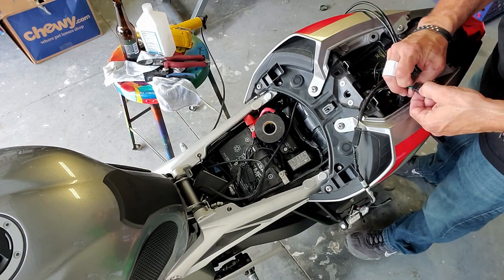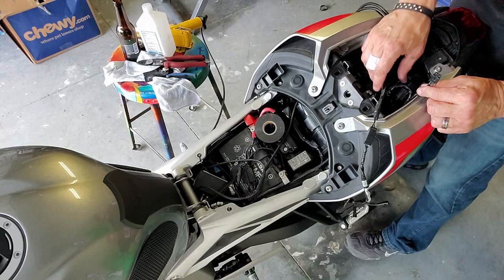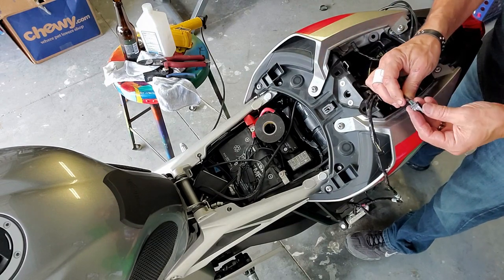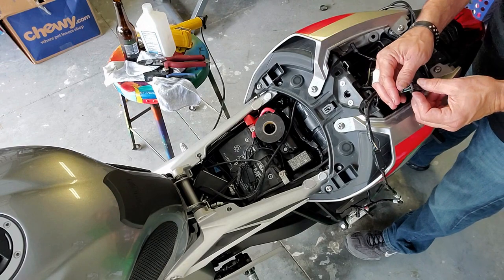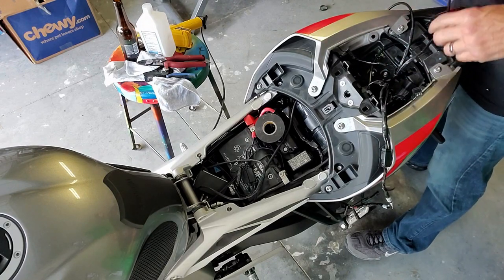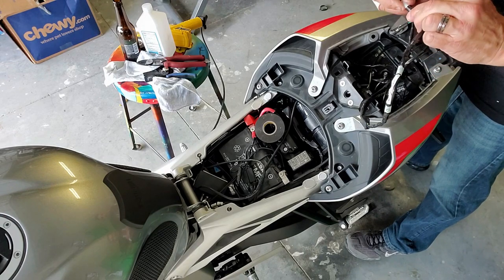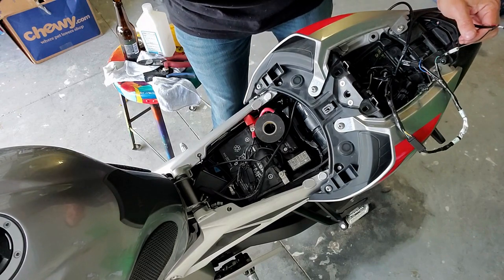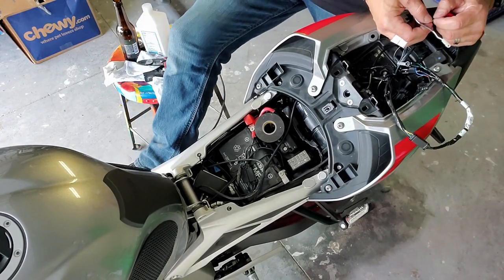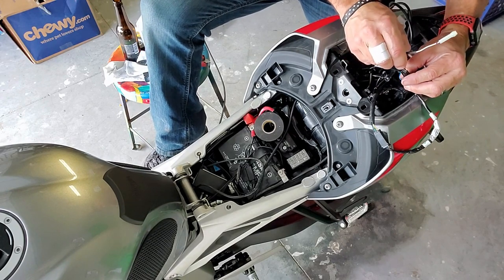The stoplight is on this plug. I believe it's this wire right here. I had to figure it out the other day — I believe it's this wire, which is sort of purpley-blue and green. The way I can figure this out is to put the black wire to the black, turn the ignition on, then put my foot over by the brake, and stick the red wire where that green and purpley-blue wire are.